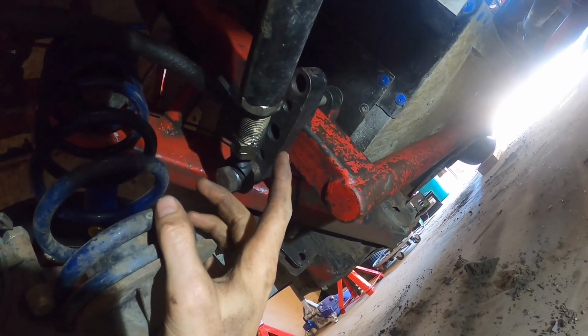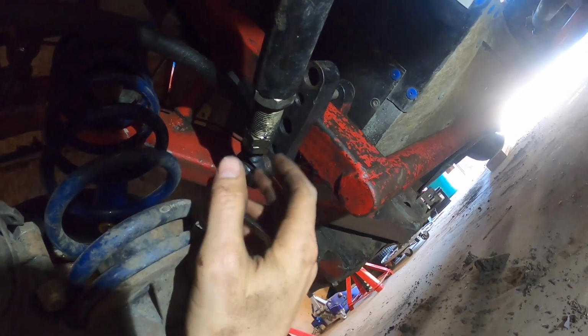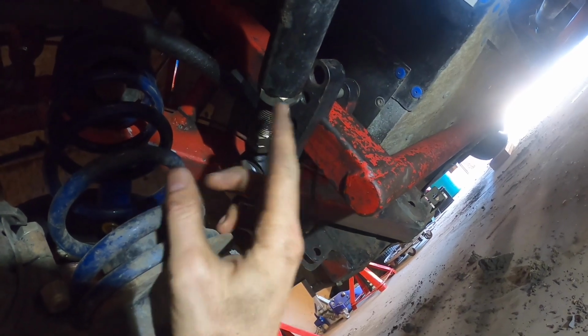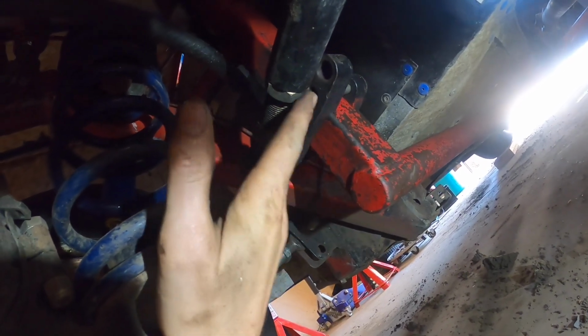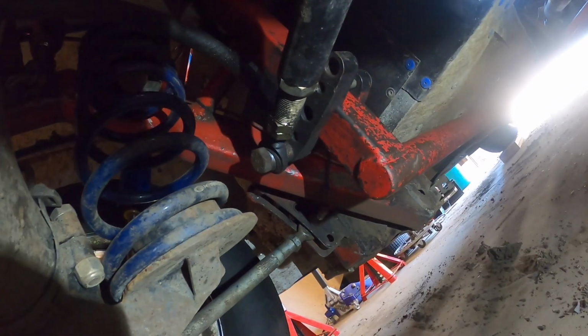And I was telling you guys in the last video, or maybe it was 2 videos ago in the race video, that I used to be at 5 inches. And I moved it up to 6 for the last race, and it was the wrong direction. I should have gone down to 4. So I'm gonna give that a shot. Hopefully that frees the car up quite a bit and doesn't plant the right rear so hard, and as you guys saw, burn it up so quick.